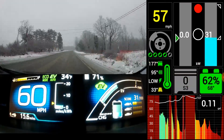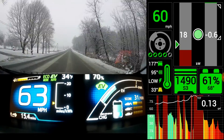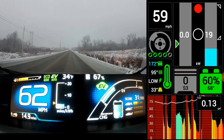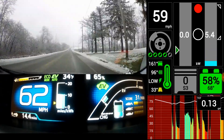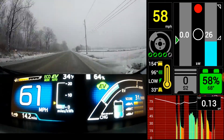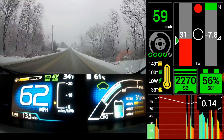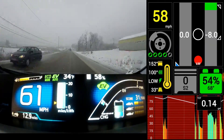We hit S3 around 155 degrees and you can see the engine will turn off as we go down hills. It won't turn on going up hills because we're in EV auto mode, unless it's a really high demand. If you were in hybrid mode the engine would turn on a lot more and you'd actually see a little bar. You'll see that when we run out of electricity later.